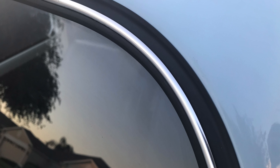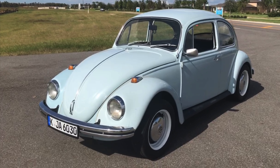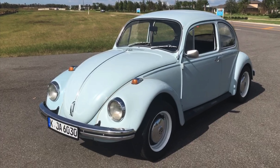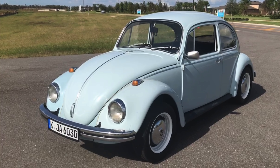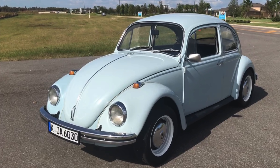I was very happy with the rubber from West Coast Metric. The only thing I wasn't happy with was that the final installation left the bottom corners not quite even — if you look at the front, the outer rubber is sitting a little bit lower than the inner rubber. When you see that, you know the seal is not exactly set correctly. But since I installed the windshield in the dark I wasn't going to worry about it. In the end I consider it a win because I was able to remove and install the glass without breaking it and I solved the water leak problem, so through all that frustration there was reward.